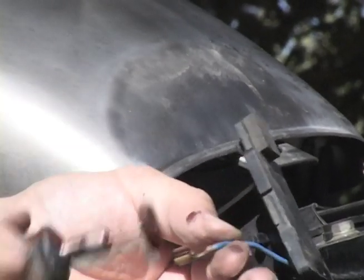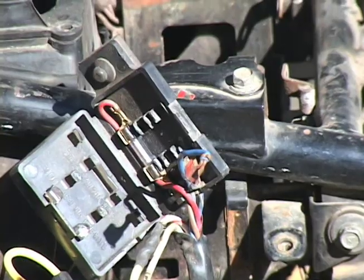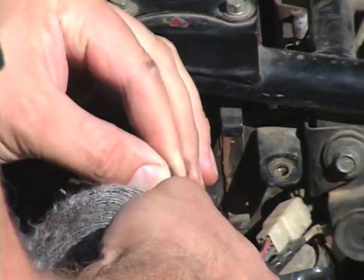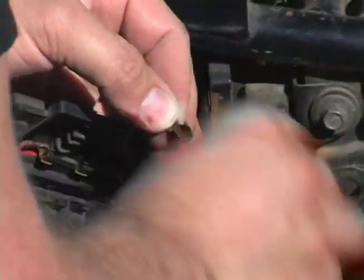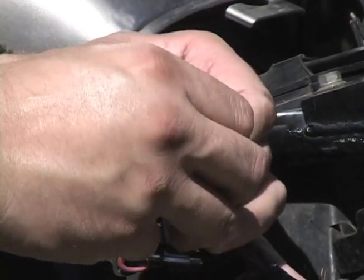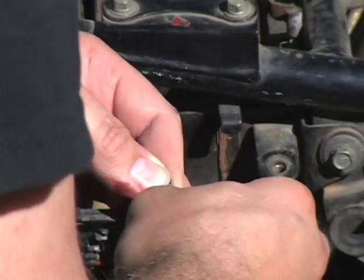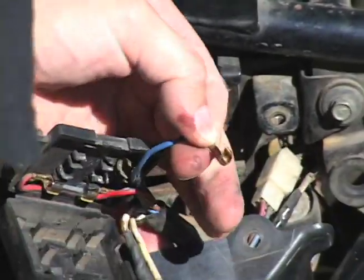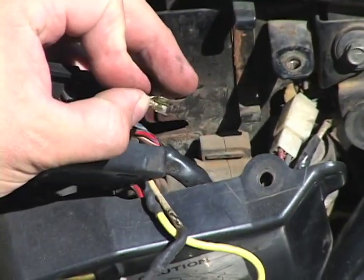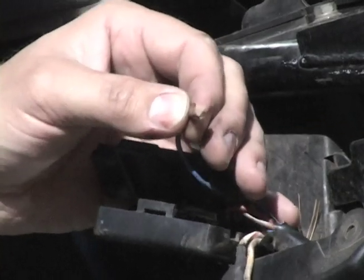The rouge turns dark as it gets filled with metal. Now it's covered with goobers — here's what you do about that: you just wipe it all off. Q-tips are handy for the middle of things. You can see already it's an incredible finish where I've got the stuff off, so I'm going to keep on this job.